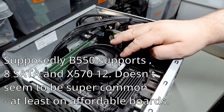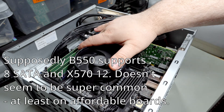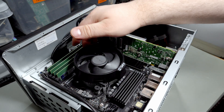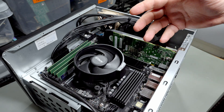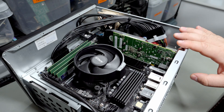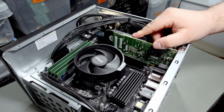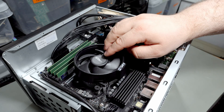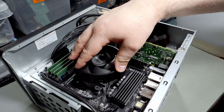You may be able to go up to X570 for more native SATA ports, or you can always put in an HBA. This board does support ECC — I've confirmed that. I've got four sticks of 16GB ECC TimeTec memory; it's kind of a no-name brand but I've been using them for years without any failures. I've also just got an Nvidia Quadro 410 junk video card in here just for graphics support, and I have a spare Pro APU which I'll probably swap in.